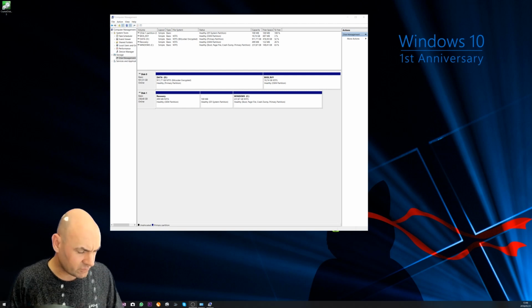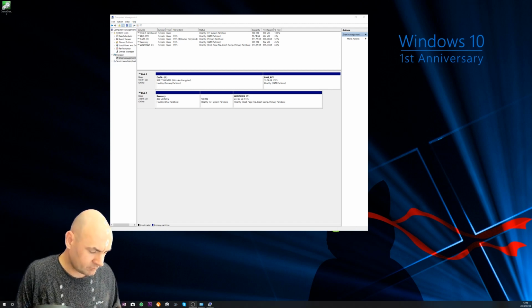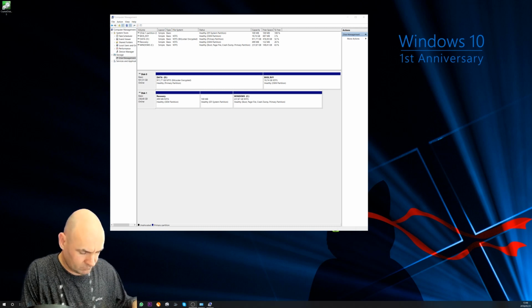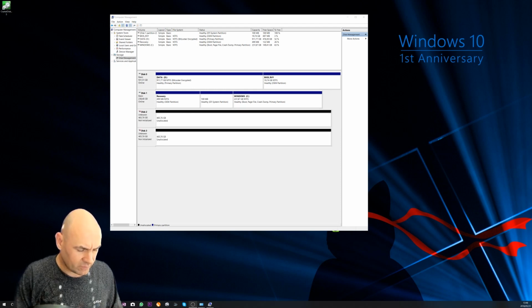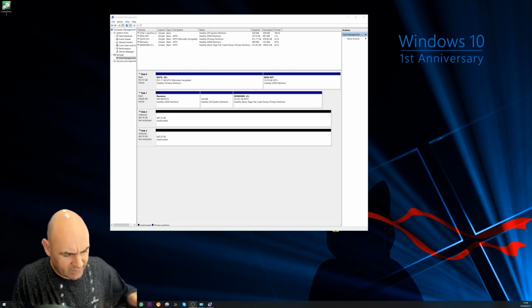All right, switch on the enclosure, switch 1 and 2 to off, then press reset button until the light of disk 1 and 2 is on. Okay, let's try that. Okay, disk 2 is on, so I'm going to press the reset button. Okay, the 2 lights flashed. Great. Okay, now what's next?